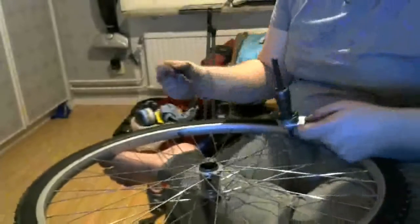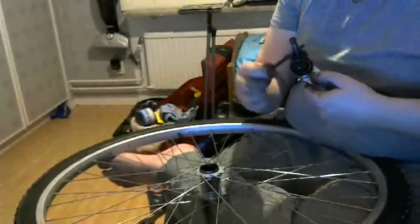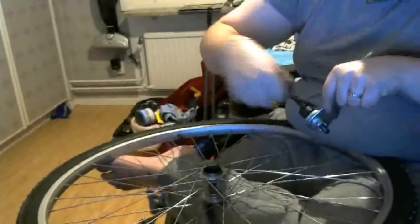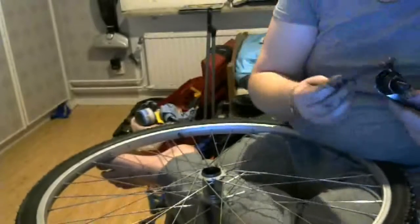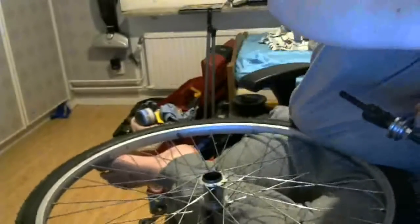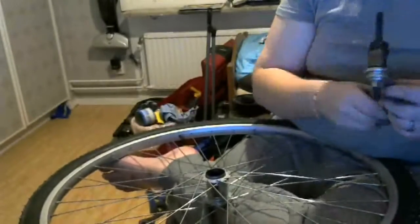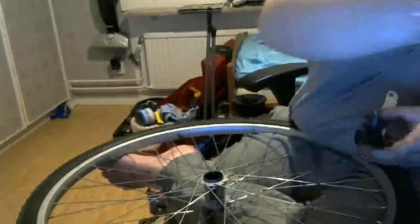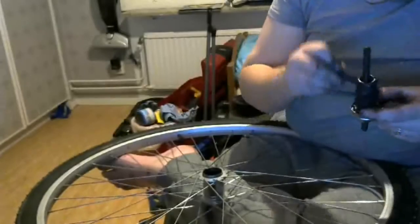I have mentioned the graphite lithium grease earlier, and I'm using that simply because, according to the store owner, and from what I've read, it's the best grease I could get for cheap. There is clearly better grease like molybdenum disulfide, but I really don't have the budget for that, and it was not available at the local hardware store. I needed it now, not in 2 weeks, so I didn't feel like ordering it.